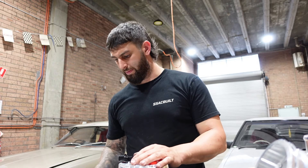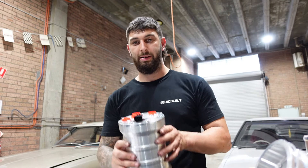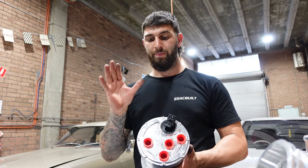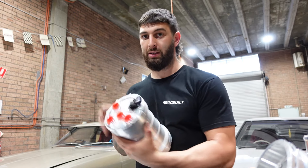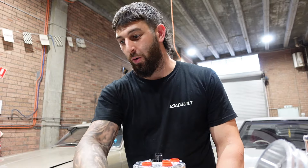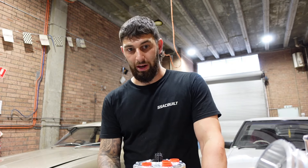Just kidding - that's what Nick did as well. But if you're watching this, Plasma Man, sponsorship would be nice. Here she is. This is the surge kit. It has twin pumps in there already, it's all wired up. I just need to add two more pins into this wiring here for the double pump. This is a stage two kit, so it literally comes with everything. Pretty much all of the fittings are actually already fitted to the hose, so I don't have to sit there and crimp anything. So I'm super excited - makes the process a bit easier.